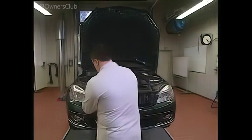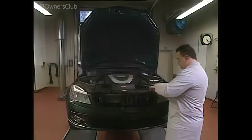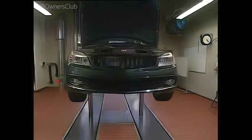You can now get to the first bolts securing the bumper. They are located to the side of the grille cutout. Once you have removed the bolts, raise the vehicle to chest height.